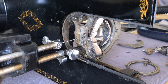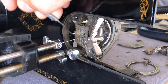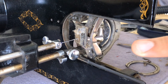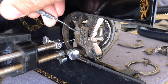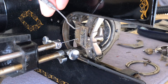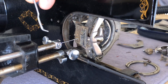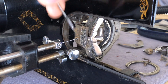This one hasn't been cleaned in a long time. Sometimes people just forget — the machine's moving and sewing and they're not paying attention. Or maybe someone borrows it and doesn't know how. It's very easy to do; it doesn't take long. It probably takes more time just getting the plates off. I took the bobbin plate off anyway. Here you can see more of this stuff — sometimes a little bit, sometimes it's caked on there. What I'm doing here is taking this little dental tool I purchased at a flea market and just pulling and pushing to see what I can dislodge.